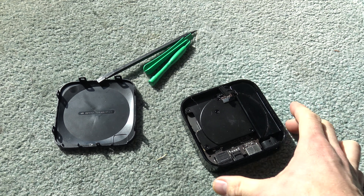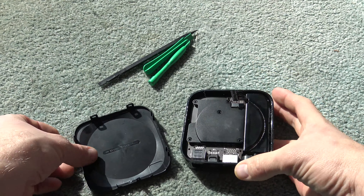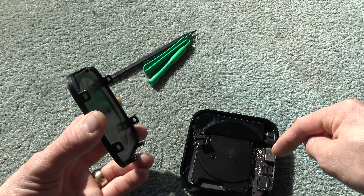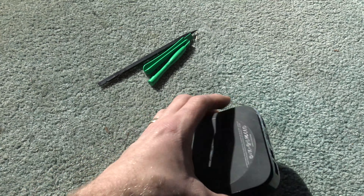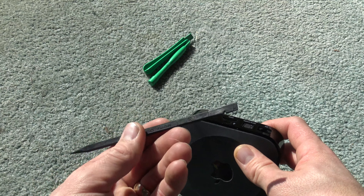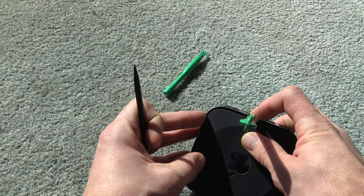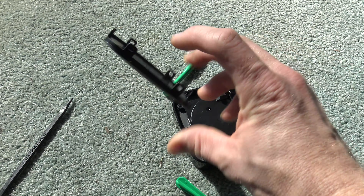I've got the cover off — there are a lot of videos that show how to do this. What holds the bottom plate to the Apple TV are little clips that are down below. I started with the back one, got it a little loose, worked up, then held that open with one tool while I did one of the sides. That got the corner open, and then I slowly worked my way around being as careful as I could not to break it.